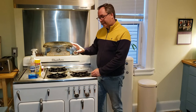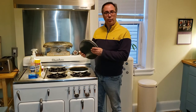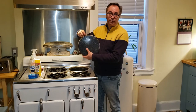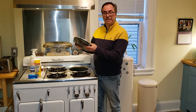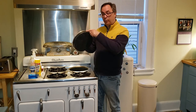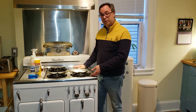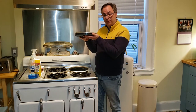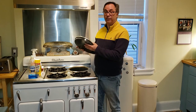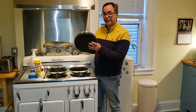So that's what you need for general maintenance. But I kept saying 'but not for the thermo-well lid,' so let's talk about that for a minute. The reason the thermo-well lid is its own special case is because of its construction. If you look around the inside edge, you'll notice that the aluminum is just folded over — it's crimped onto the enamel, and inside is insulation. If you submerge this in water, or spray water from your sink sprayer into the seam, the water is going to get in and soak the insulation, and it has nowhere to go. Your insulation is going to stay wet, and then you put it down on the thermo-well, which is always warm, and eventually this is going to pop and you'll wreck your thermo-well lid. So never submerge it.